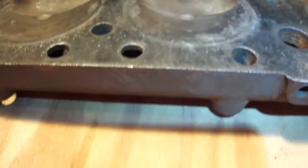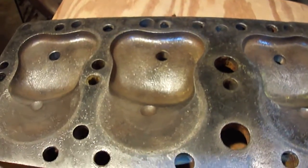I also checked it for warpage, and it was off by about five thousandths of an inch — one of these between cylinder three and two, I think.